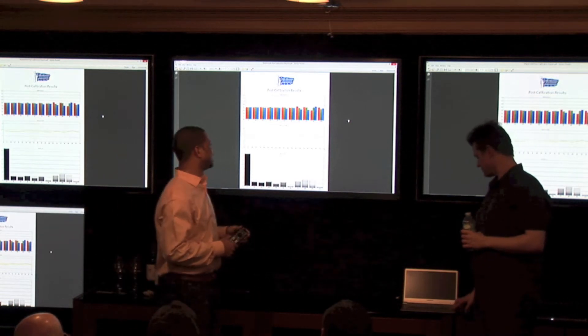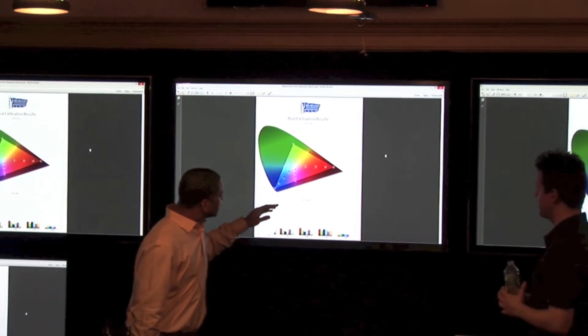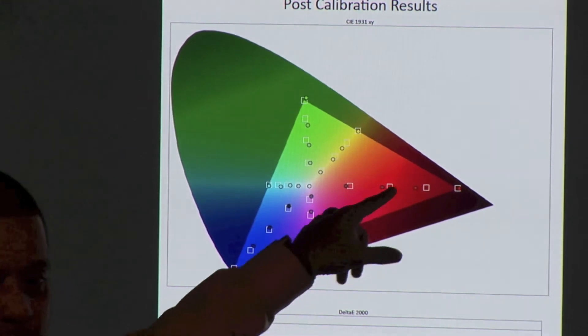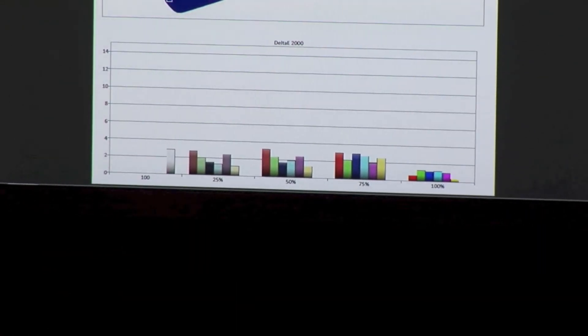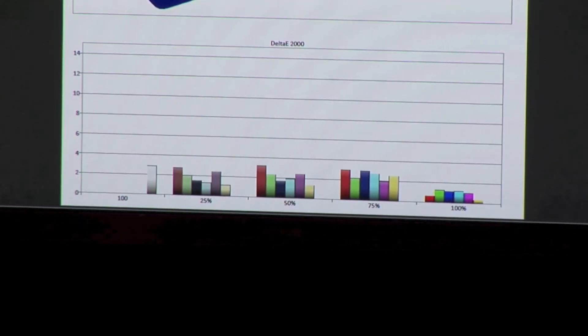Should we go to color? Oh, look at this — a little bit of image retention. This is all Samsung right now. On the Samsung, as we can see, it's tracking straight, but it's not tracking where it should be at these other saturation points beyond the 100 — beyond the outer. But even with that, it's still pretty good because with this delta E formula, the errors are at three or below three. I've been looking at content that I did color correction work on in all of these, and I was not happy with any of the plasmas.